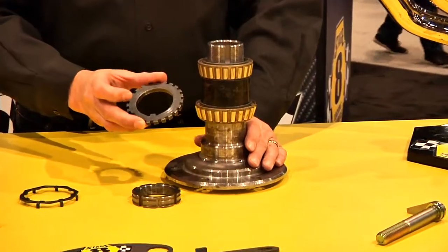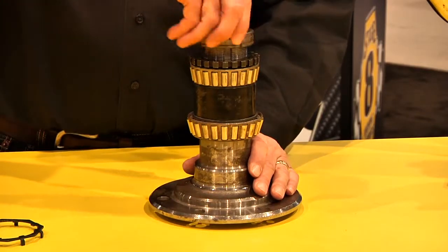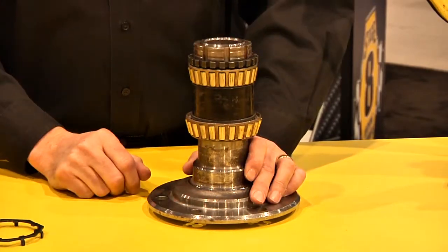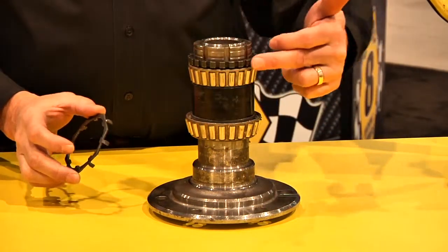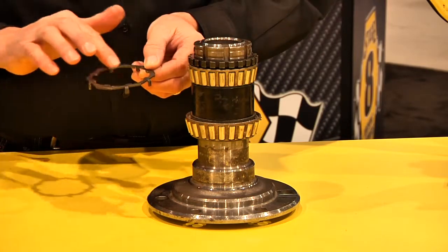This is the notched washer that goes over the keyway on the spindle — that's your first step. We only use one nut rather than a dual jam nut system. The nut goes on and, let's say that's your clamp value right there — we can lock it in this exact position. There is a prime number of notches in the notched washer, and a prime number of tabs in the locking retainer with an even number on the inside.